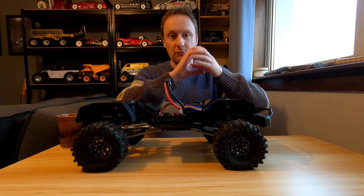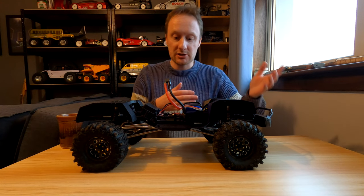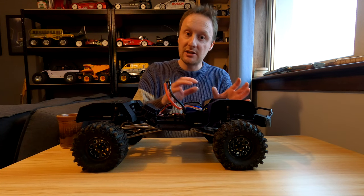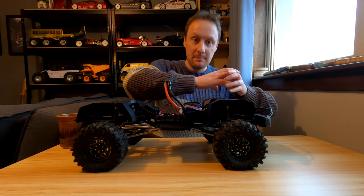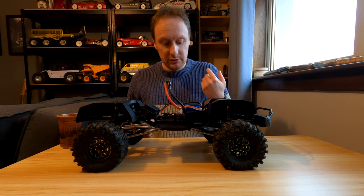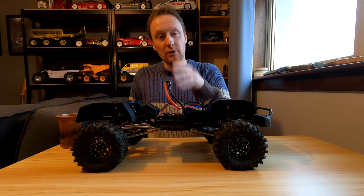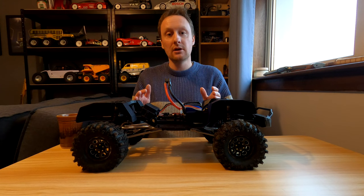There's a lot of slop in it. So when it moves in, there's a sudden slamming of the gears — a sudden slamming from low, slamming into high. It's not smooth. What makes it worse is the truck has to be moving ever so slightly in order to change gear, because otherwise it may slot in, but the chances are it won't be lined up properly unless you're moving. So when you're moving it'll click in and then it'll drive, whereas if it's not moving it may just bounce off and not do it properly. I was hearing stories of people where it'd be on a slope and then it would just roll backwards because it'd fallen out of gear. It's a poor two-speed.